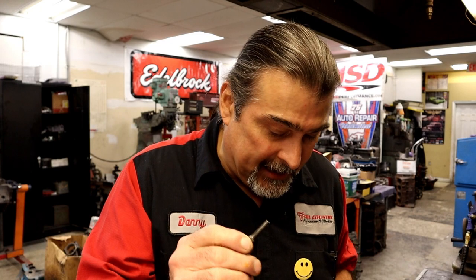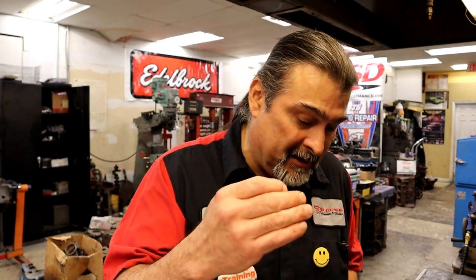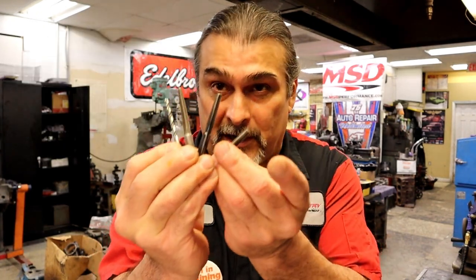So the plug itself is cast iron, and the cylinder head is cast iron. You can use this on blocks. You can use this on anything that's cast iron, tractors. I learned this the old school way as a kid. I would just plug all day long. Basically, we're going to drill it, ream it, tap it, and then plug it. All right, so let's get going.